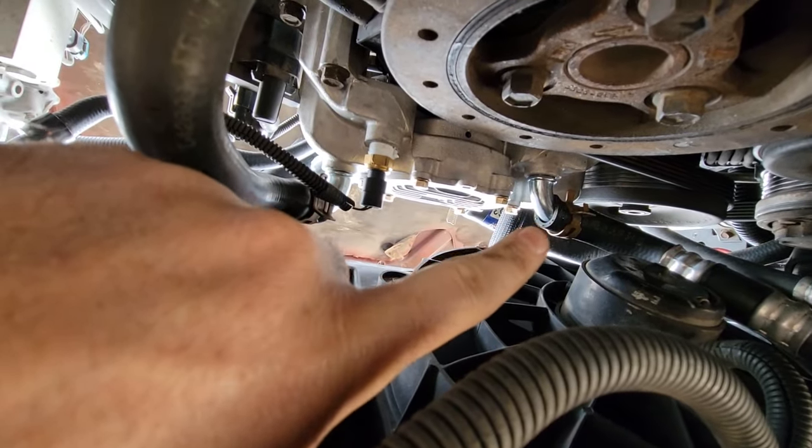Now we're at the point where we can connect our fresh air inlet — go to the air intake here, take a 3/16 drill bit and drill a small hole right about here, and that is what the inlet is going to pop into. The final step is to bleed your cooling system to get all the air bubbles out. Unscrew the bleeder slightly, run the engine, keep topping off, and once it starts to rise go ahead and cap it — wait for fluid to come spilling out of here, since this is the highest point. Once it's squirting out, you're good to go. Thank you very much for watching, have a great rest of your day.